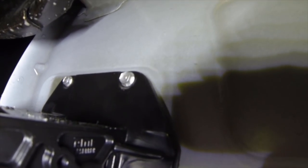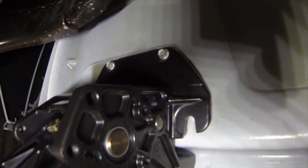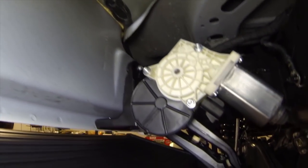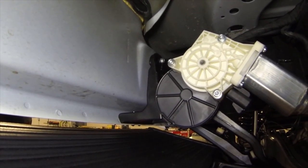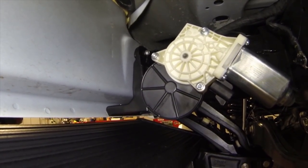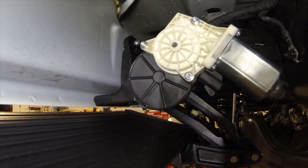They mount into all the factory bolt holes so there's not a whole lot of modification needed. The kit gives you rivets for the top holes, but I went with screws because they're more heavy duty and you really can't get a rivet gun or drill bit in there. The motor is all mounted in, and we're going to get the wiring going - it runs to power, ground, and OBD2 for the door trigger, plus we're running LED lights to light up the boards when they open.